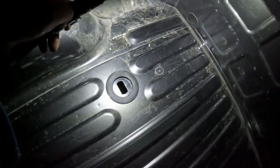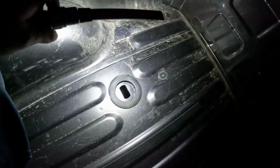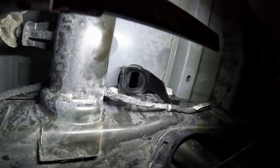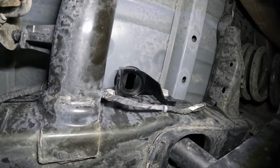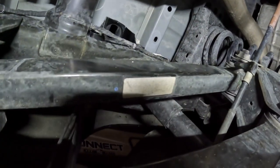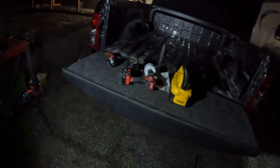On the fronts I cheated — I didn't even measure. You can get to both sides, even the side with the fuel tank, from underneath with a drill bit. Come up from underneath that way and you don't have to measure, guess, or whatever — just drill your pilot hole, then run the hole saw from the top. Also, add a shop vac to the tool list — bring one out with you to get rid of all the shavings. I already shop-vacced out the bed as I was going. Call it a two-hour job — that's all you need to put these pucks in.